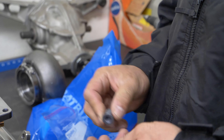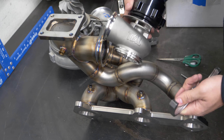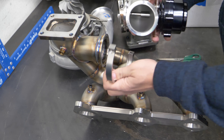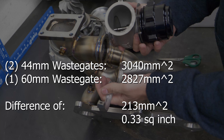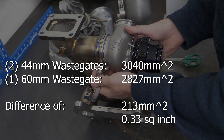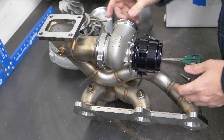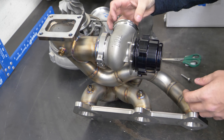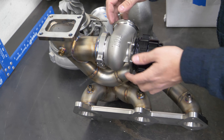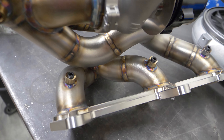Yes, I can bring on washers, so it's not just like that — a nice washer on there. So here we have the 60mm wastegate, which is massive compared to my two 44s. But the surface area of one is almost the same as both of those. I'm not exactly sure how I'm going to mount this in terms of the exhaust. We'll see if we have enough space to have it come out this way, or maybe like my old manifold, have the exhaust vent out through the bottom to the ground.